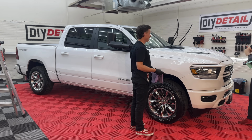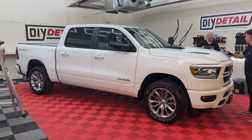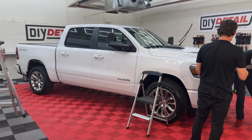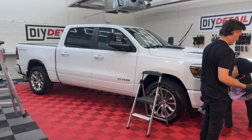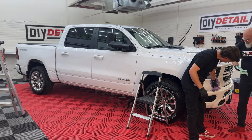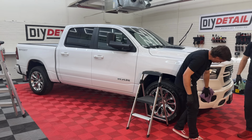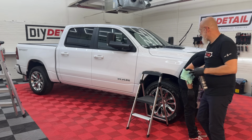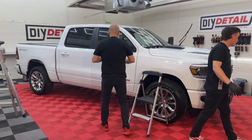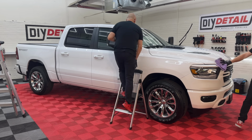They knew. And on this light green towel, all we have so far is panel prep. Not a speck of dirt, nothing. Now you notice we're wearing gloves for two reasons. One, protect us from the chemicals, but more importantly, protect the paint from our sticky little hands. We don't want our fingerprints all over there with our oil and grease on there, potentially interfering with the ceramic coating bonding to the paint in the way that it's designed.